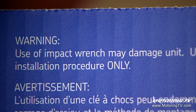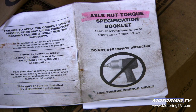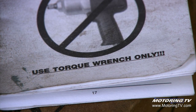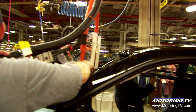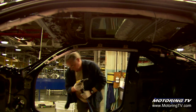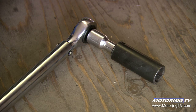The wheel bearing manufacturers caution you on the packaging — this one actually has a picture of a pneumatic impact gun with an X through it, saying don't use an impact gun, and they give you torque specs for every conceivable car. When your vehicle is on the assembly line, the workers use expensive production machinery that limits the torque on all fasteners to exactly what the engineers specify — not too much, not too little.